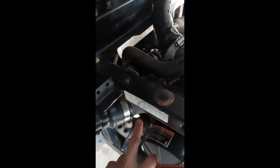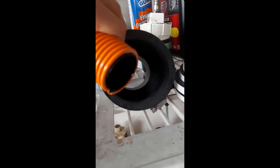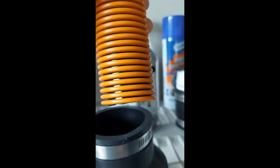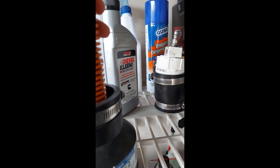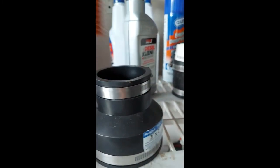Two, 2 inch to 1 and a half inch Fernco adapters. This measures two and an eighth, two and a half, but it's not bad — you use a little silicone and a heat gun, stretches right over, nice tight fit. Same deal here. This side gets a little bit of silicone, after you heat it, slide into your air box. A little bit of silicone on here, put it in, clamp it down. Another bead of silicone wrapping around the edge. Obviously this connector is much bigger — just using it for an example.